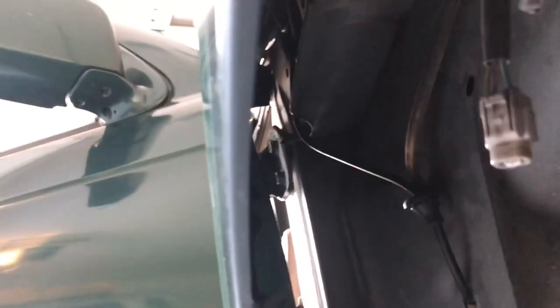Right, so you can see cables coming down from the antenna up there, and it's just gonna go right in here through the hole. We'll attach that grommet real good so no dust and dirt, water, whatever gets kicked up in there. This one right here, so it comes up from way down in there. Well, I wouldn't say way down, but a few inches below right there, a little above the kick panel, but a little below the airbag.